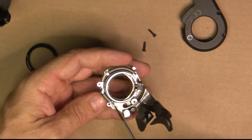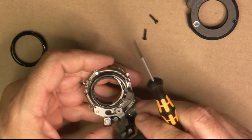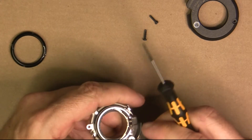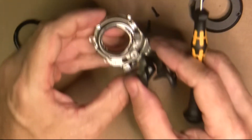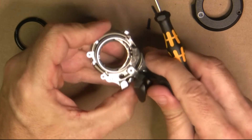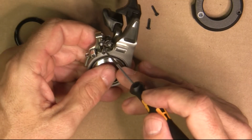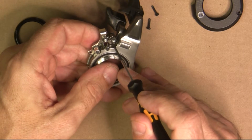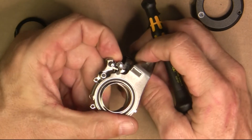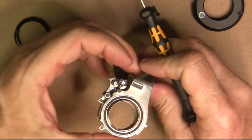What we have here is two extension springs - a first small extension spring and then a large extension spring. The first tension spring stretches when you're using the bottom clicker, and the second spring gives a little extra pressure on this clicker. Those are the two springs that provide pressure to make it click. The clicking mechanism is here on the back - as it actuates, this little device comes in contact with this device, and you'll see it click - first click, then a little bit harder ramp on the second one.